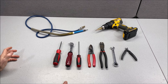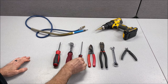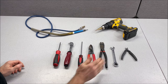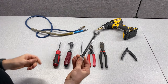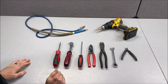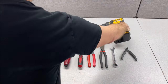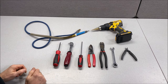The tools needed for installation are: a Phillips head screwdriver for the battery terminals, a T25 Torx screwdriver — possibly a shorter or right angle version for tight spaces — a set of wire strippers, wire crimpers for the battery terminal ring connectors, a half inch wrench preferably ratcheting style for the tight quarters when mounting the amplifier, a set of flush cuts for trimming behind the scenes, and either a drill with a step bit or a Dremel with a spiral end for the grill modifications.